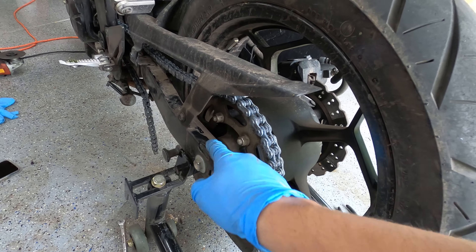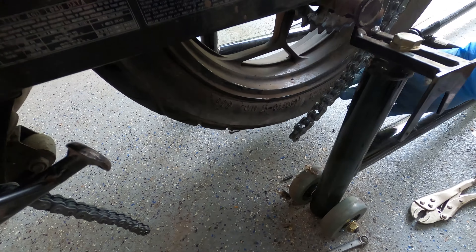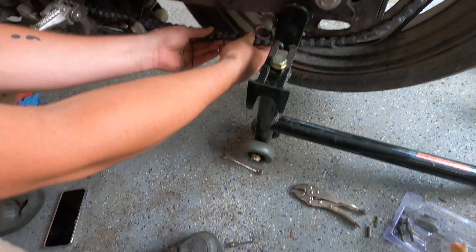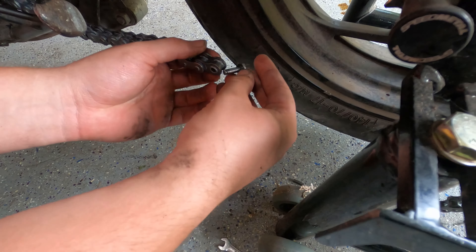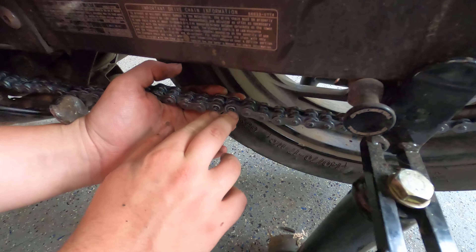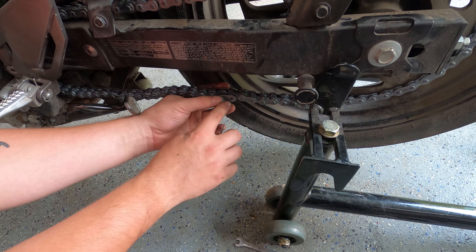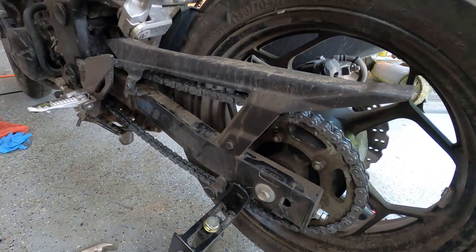One thing we did to make sure we have enough adjustability for chain stretch: we ran the adjusters all the way in and pushed the tire forward, which also let us take another link out of the chain. Now everything is copacetic. To install the master link, we line up those two ends, then take an O-ring that we've greased and stick that there, and another O-ring on that one. Then two more O-rings right here. Grab one of the plate-looking things — the plate goes first, and then your clip. You have to beat these on usually, but this clip will slide on — it's got little indentations where it slides and snaps into place. A few taps with a screwdriver, got that clip on. Now we just adjust the chain tension and we're good to go.